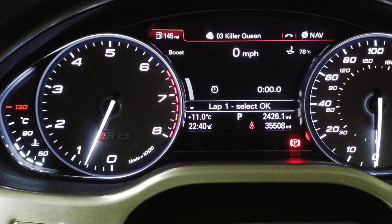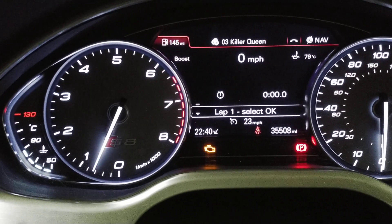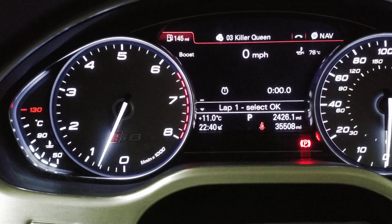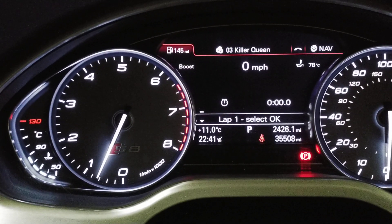Map switch three is the high pressure fuel system. This is barely registering — range zero to twenty megapascals — at present only one and a half megapascals at idle.